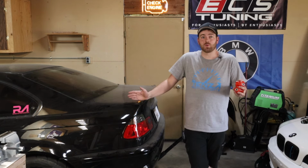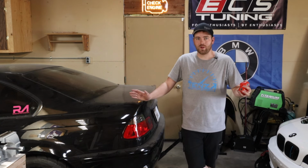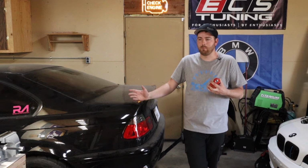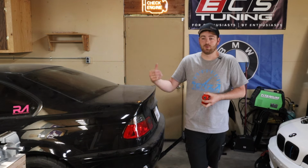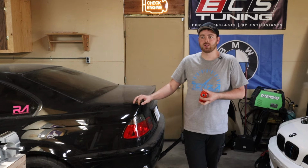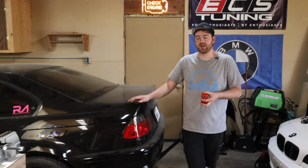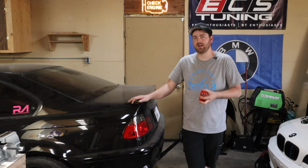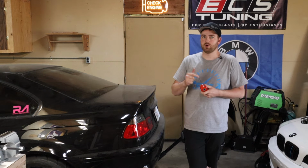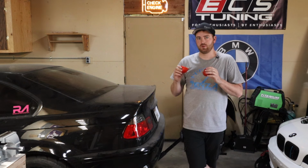A lot of us don't do the rear ends. I mean, I've been building my white car, again, the one that's just over here, for like 7 or 8 years. And I just barely did the rear end in it. The reinforcement plates and then all of the bushings. And it is a big project. I spent several days doing that, just straight, like 6, 7, 8 hours a day for a couple days straight. So I understand that it's a pain, but if you can get yourself a bushing puller and press kit, these really aren't that difficult to do.